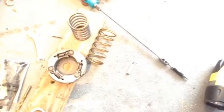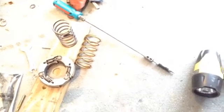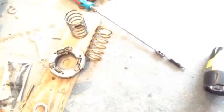And the belts are $30-40. So we don't want to start wearing those parts out for the sake of a $10 or $15 spring. And we don't want to keep going into this machine to change belts. So I'm going to put the softer spring on, and I think that is going to fix this dilemma. And I think I'm still going to have that rip-out power, especially in the dirt, off the line, which I didn't have before. And I think that's it.